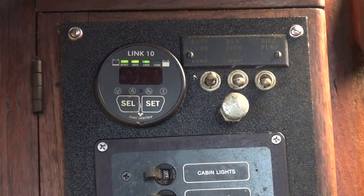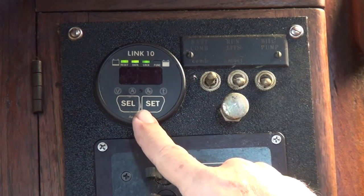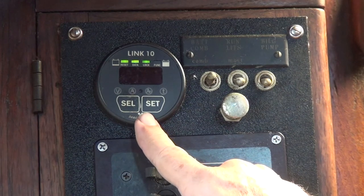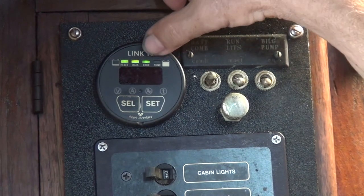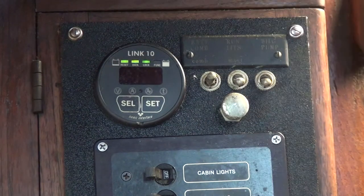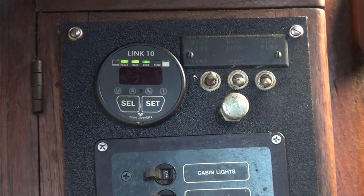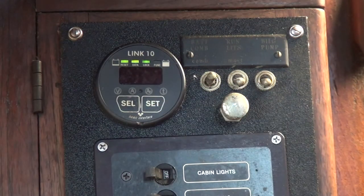What I do is set the gauge and tell it that I only have 150 amp hours worth of battery capacity. That way, when that last LED starts to turn red, I know I need to recharge the batteries. Had I told it 300 amp hours, I'd be looking for the center one to turn dark — and I could overshoot and not want to. So that's my first hint: program it to half your actual capacity.